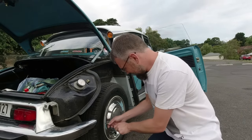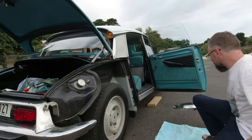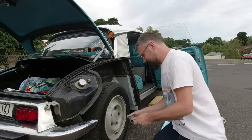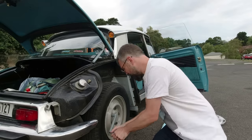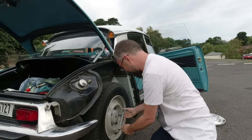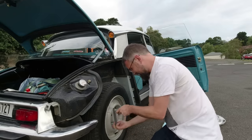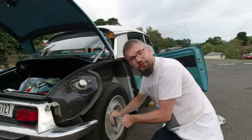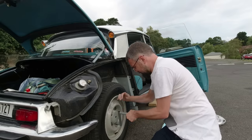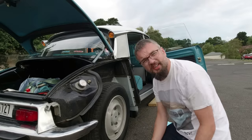Now there's a small job of removing the wheel trim — just getting behind it. There we go, that's off. And now hopefully we can crack the nuts with this bar. They've been tightened to the perfect amount, but you can actually undo them without having to stand on the factory-supplied bar. Incidentally, this was a question on my driving test. My tester said, what would you do before jacking the car up? And the answer is you loosen the nut, so you're not having to put that force through the car that's on the jack. They're all now ready to come off.